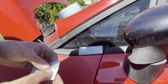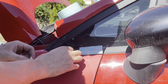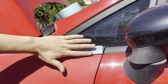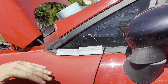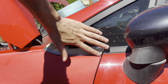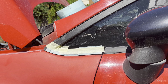This is trim tape. There's hard plastic here and then tape beneath this white cover. What you do is slide it in the seal, pop it in there, and peel the tape off. Then you pull this up and it creates a gap between the panel and the trim. As you can see, there's a gap for the lacquer to go into so it doesn't make a seal on the plastic trim - otherwise you get a build-up and it'll look awful. This lets the clear coat run in under the seal and you'll have a lovely finish up towards the edge. Then I like to get some 2-inch masking tape and reinforce that tape towards the panel to keep that gap there, because sometimes the tape is quite weak or the surface is dusty.